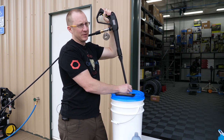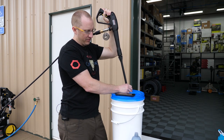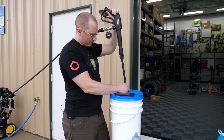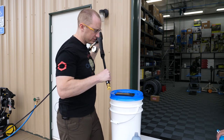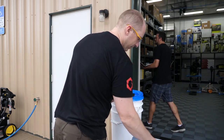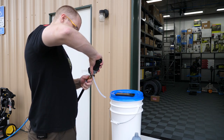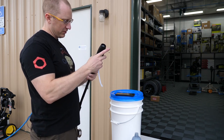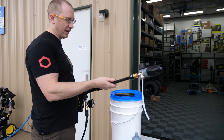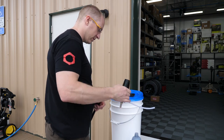There's a significant weight difference between the 1700 and 1800s and then the 1900 and 2000s. It's pulling a lot of amperage — 15 and a half amps. I have it on a dedicated 20-amp circuit. Let's see if the foam cannon fits. Yeah, cool. So they actually did a proper depth quick disconnect, so if you wanted to throw your foam cannon on the end here, you could.